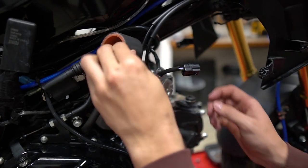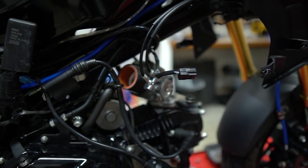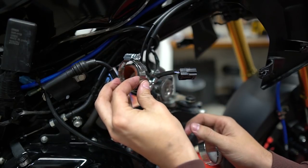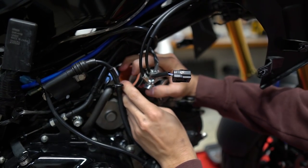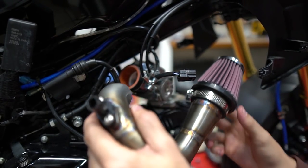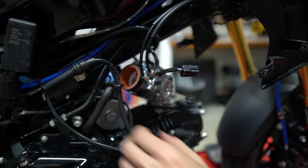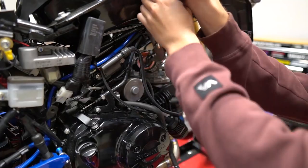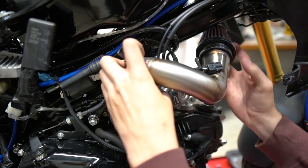Going back to the bike, I got this little silicone piece — I'm just going to sneak that in there and put that on the intake manifold. Once I get this on, I'm going to sneak on both hose clamps. I'm making sure it's really pushed on there and sealed. Then we're going to get our intake and it looks like we've got to get it past this ignition coil. The hose going through it is the breather hose. There's a little metal bracket here — I'm going to bend that out of the way. Actually I went ahead and broke it off; I figured it was kind of unnecessary. Now we should have a straight shot to position the intake.